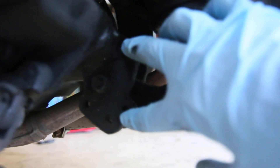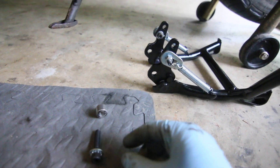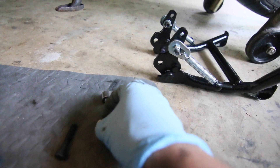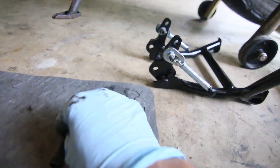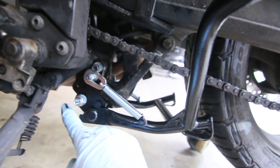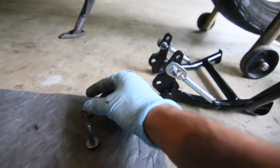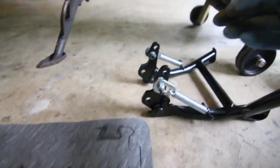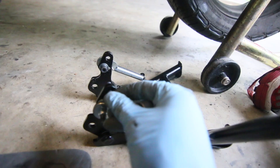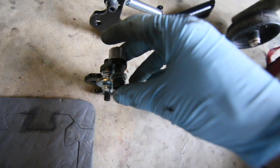So these are the two bolts you'll be using. First thing you have to do is install the top bolt — this is the top bolt that comes with the Happy Trails center stand. Then you have this star-shaped washer, and that goes in first according to the manual. So I just put these bolts on here to see how it fits. And then on this side, you have a spacer, so this is where the smaller diameter bolt is going to go. The top — you'll put this on this side, and that's going to hold it together.